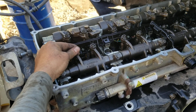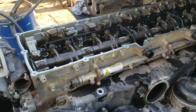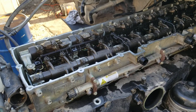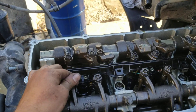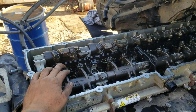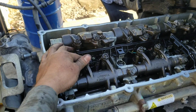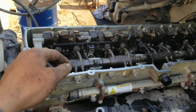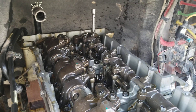From what I'm seeing, it's not going to surprise me when I take this head off and look at the valves — they're more than likely going to be burnt. And it's not only on cylinder one; basically all the intake valves are tight on this engine. They just don't have any slack even though the cam is not on the lobe — they're completely tight.